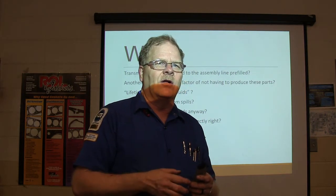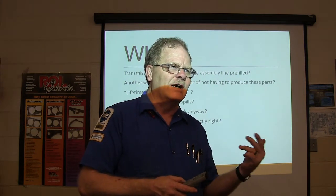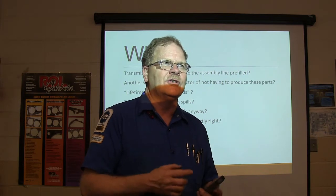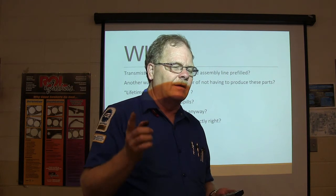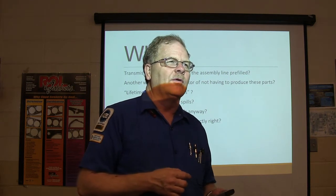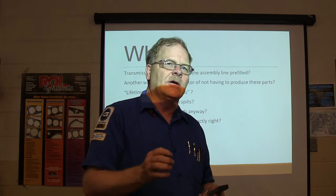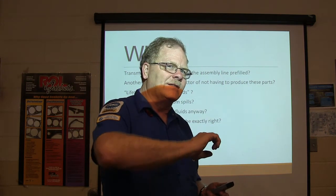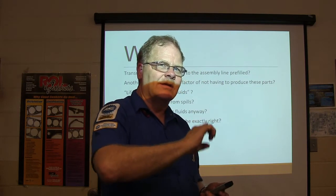So I called and talked to Dave Farley down in New Orleans with Chrysler, because Chrysler and Eagle were at the same outfit at the same time. Chrysler bought Jeep, and Jeep became Jeep Eagle and all that. Anyway, he said, put ATF+4 Mopar fluid in it. I didn't think that was going to fix it, but it took care of the problem. I did notice that when I put a dwell meter on the torque converter line, it wasn't just locking the torque converter straight up all the time, but it would lock it up in stages, you know, percentages.